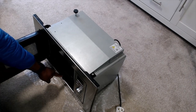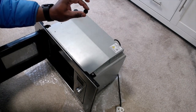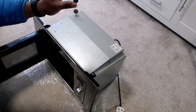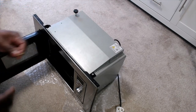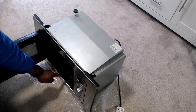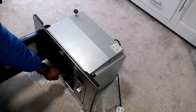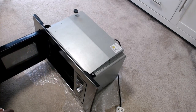Once you've opened the door, just at the base of the panel of the microwave you would see a small cap. The cap looks like this. Remove that cap and you should find a screw — it's usually a Phillips head screw. You can simply remove that screw. It would be found just at the base of the microwave once the door has been opened.